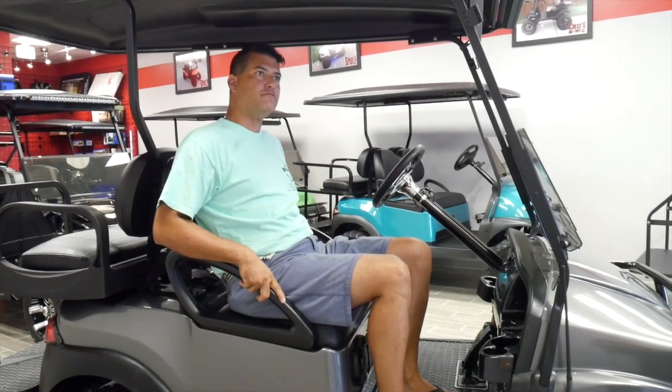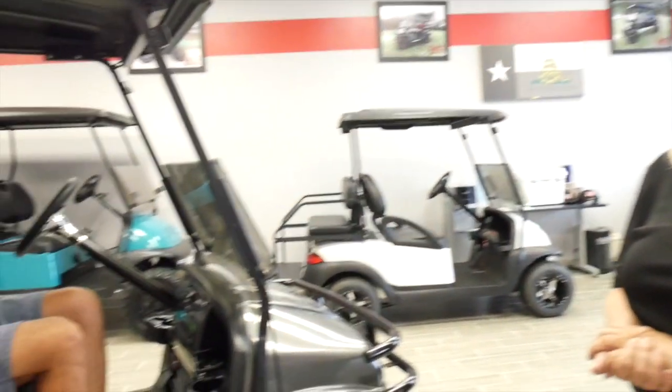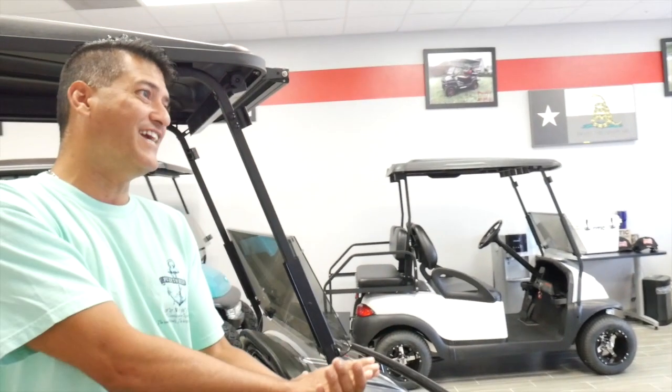All of our golf carts that have any type of rear seat or utility bed added to them, we include a set of heavy-duty rear leaf springs so the cart doesn't squat down when people get on the rear seat and you don't have that tip and over feeling as you're turning corners. That's really important — I was on a friend of mine's cart not too long ago and we just sank all the way down.